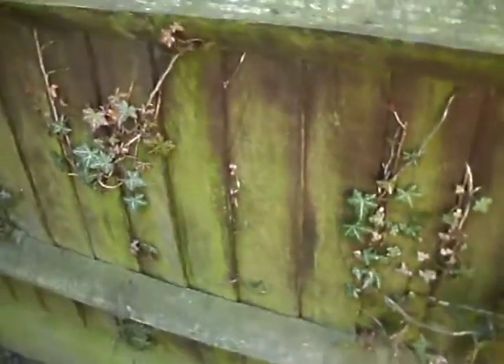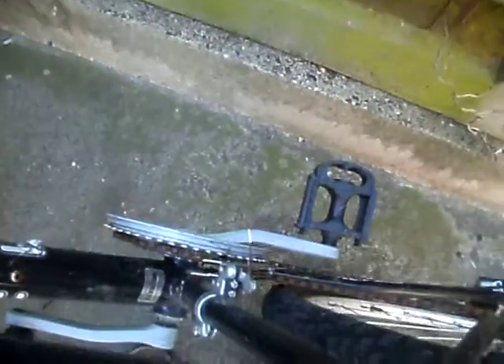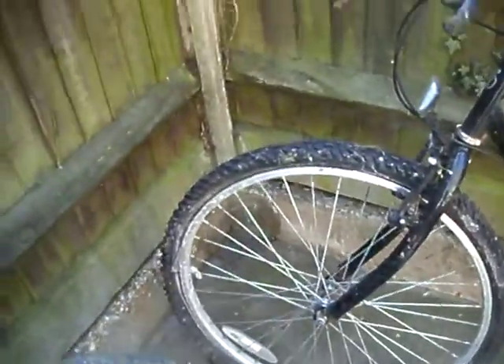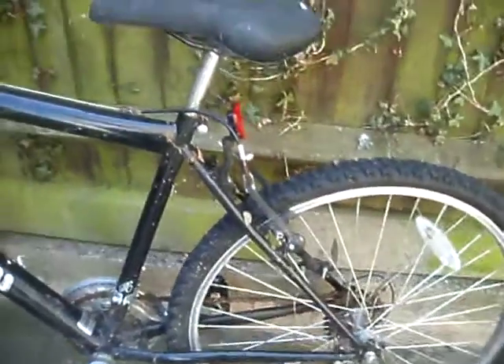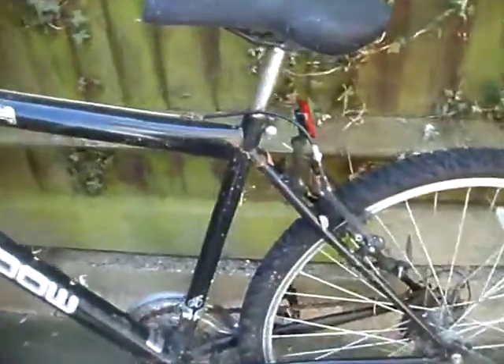All the gears still move. Front derailleur here — it was moving. The gear shifter moves, at least. Brakes — good clean down, new rim tape. Tyres look okay. I think a good old clean down and a new chain. That chain is rusty as hell; I'll just cut it off with a hacksaw. I'll never use a chain splitter on a rusty chain like that.